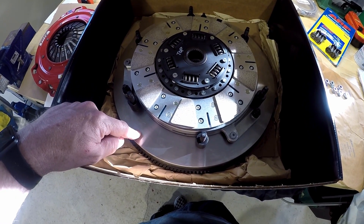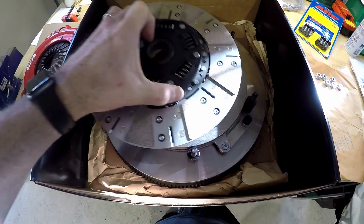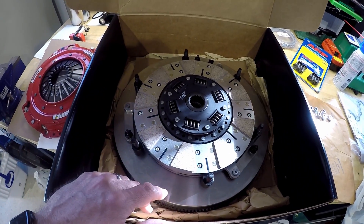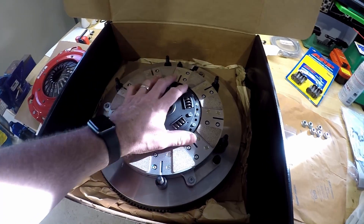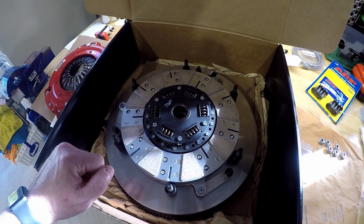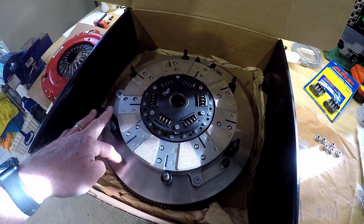In this episode I'm going to be grinding the flywheel and then balancing the assembly without the discs — I'll take the discs out, have the floater plate torqued down, the pressure plate torqued down, and then dynamically balance it. That is also recommended by McLeod. I've read a lot of things on the forums about people installing clutches and having vibrations at certain RPMs, or things not engaging and disengaging correctly, or having chatter. Some of that can be attributed to not properly prepping or balancing the clutch.